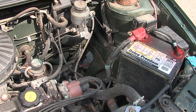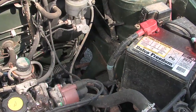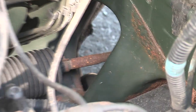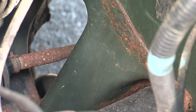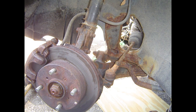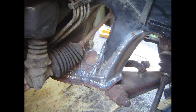Another thing you're going to want to check for is any known issues in your particular vehicle. It's known that in GeoMetros, they're a unibody design, and often this part right here — just in front of where the drive shaft for the front wheels goes through — will rust through. This part of the frame is known to rust. In my case, when I had the engine and transmission out of the way, I started poking that real hard with a screwdriver. And even though it didn't look bad from the outside, it was completely rusted from the inside. On my car, that did need some repair that required welding. Fortunately, my friend Tim is a small guy — we just put him in there, had it welded up, put some black paint on there, and we were ready to roll again.